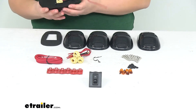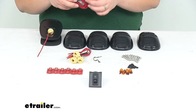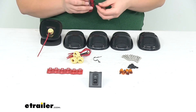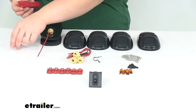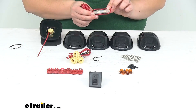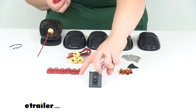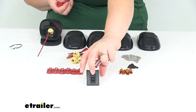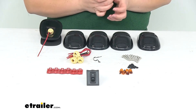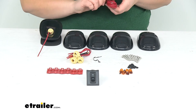Whenever it comes to installing, you'll want to use one of the quick splice connectors to tie in with that bulk wire. It's just going to run between all five of our lights, and if you have that wiring run into your vehicle you shouldn't have to worry about any kind of water getting in there and causing any damage. The quick splices will do a fine job to get you connected, and then we'll also have a fuse to come off the back of our switch. The other end of our bulk wire goes into that switch with those spade connectors. But if you're putting this on a newer truck, there's a good chance you could void your warranty by hard splicing into the wiring.